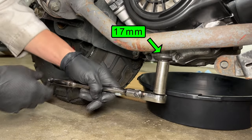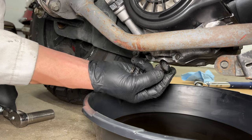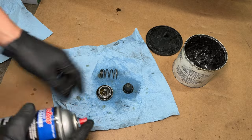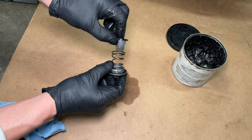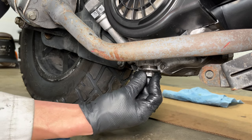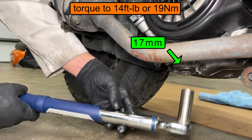On the right side of the scooter, you'll find another plug under the engine. This is the oil screen — it's like a filter, but only catches big chunks. Clean it out and add a little bit of grease or oil to the O-ring. Stack the small end of the spring into the plug, then put the screen inside it. Push the cap, spring, and screen straight up as you turn it clockwise. Use a 17mm socket to tighten the plug.